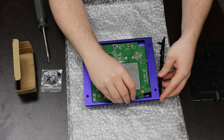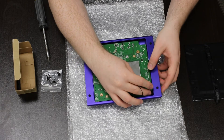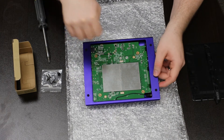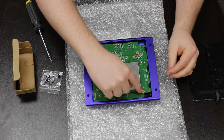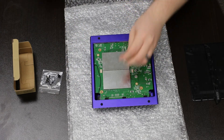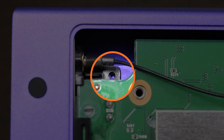Now reinstall the bezel, making sure it's flush with the PCB inputs and outputs. Now install both of the small screws to secure the bezel with the WiFi antenna connector. Using a magnetic or magnetized screwdriver will be helpful, as it's difficult to get these screws installed in the proper position. Do not skip this step. If you drop a screw into the case, be sure to retrieve it, as a loose screw will short the board.